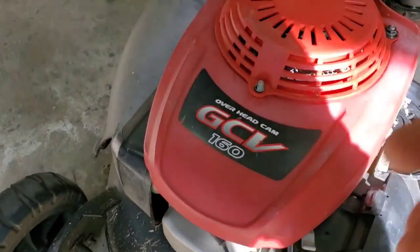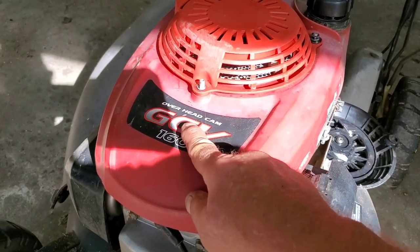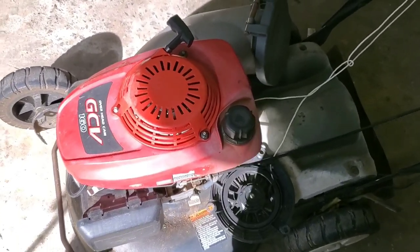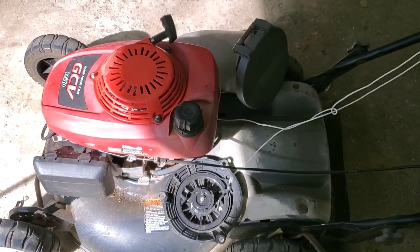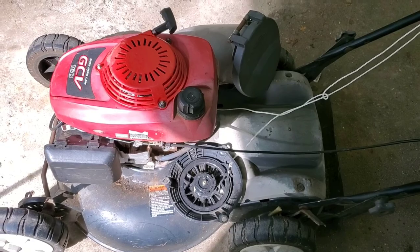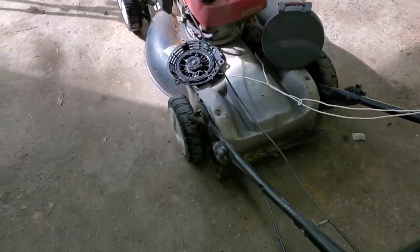What I'm probably going to do — behind that stud where it comes up out of there, I think it's too small for a helicoil, which I don't have anyway, so I'm probably going to drill it and put a set screw in there. I think that coil will stay, but this machine is just not worth going a whole lot further with it, especially with it smoking like this. All right guys, have a great day, thanks for tuning in — click that subscribe button. Rayleigh's Small Engines — we're gone.